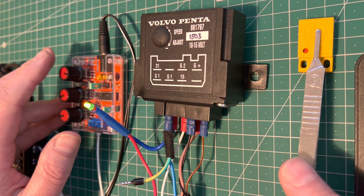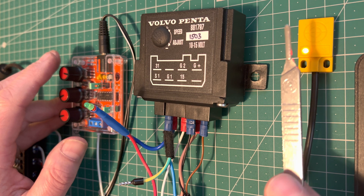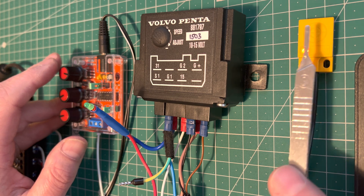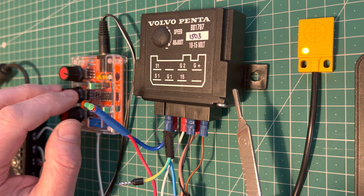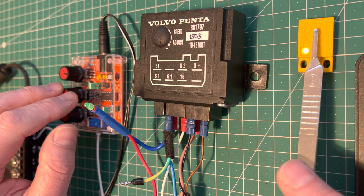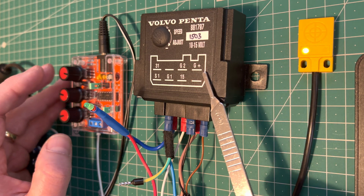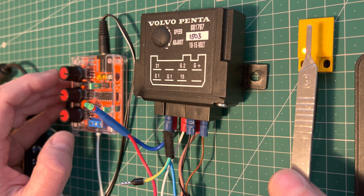But if I go to the proximity sensor, I can still energize the supercharger — I'm at a low enough RPM where it's not locked out, even though ordinarily the supercharger wouldn't be running. And if I increase the revs even further and try the proximity sensor, you can now see it's not lighting. So this box is preventing the supercharger from being engaged via the proximity sensor when you exceed a certain RPM.